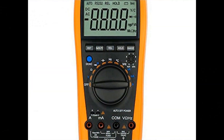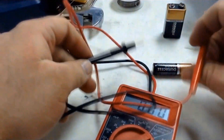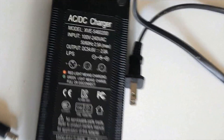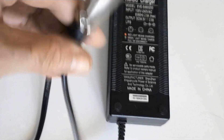Some basic things to consider in troubleshooting your battery: have a voltage meter — you can buy them for under $30 at any hardware store. The voltage meter will directly test the voltage of the battery. If you're not getting the proper voltage readout, either your BMS is corrupt or your cells are dying — the older your battery, the more likely the latter is true. It's very important to make sure you're charging your battery with the correct charger. Your charger's input and output voltage and amps are clearly marked on the back. Make sure it's designed for the battery that you have — you can ruin your battery if you're charging it with the wrong charger.